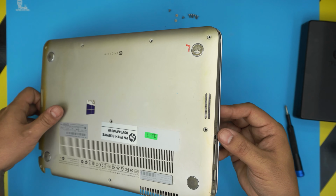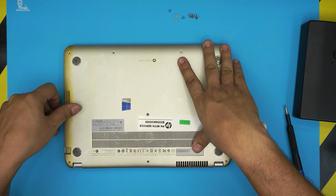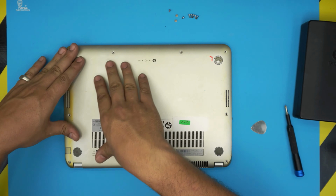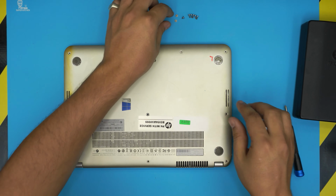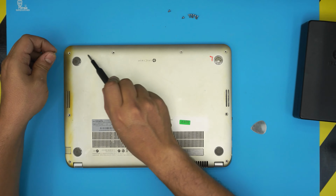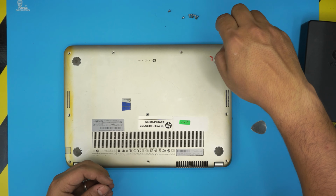To put the bottom cover in, make sure you first stick the audio jack side down first and bring it over. Just twist, push down the corners back, and make sure you hear those tiny clicks. The last thing is to grab the shortest screws, put them in the front end, and the longest screws from the middle towards the back.